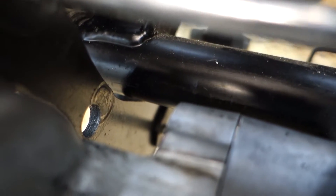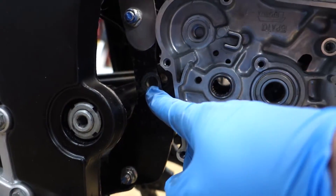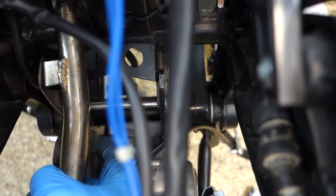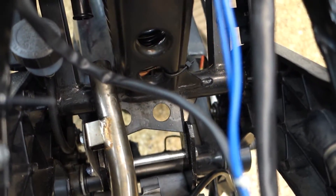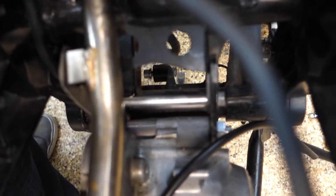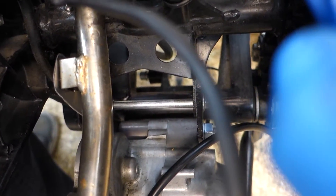There's the gap that the spacer fits in, and I'm going to throw that in right now and see how it lines up. From the outside, that's where this hole goes through — it goes to the edge of the case, right there between the case and the plate on the side. That will tie this whole unit together. You can see there's a continuous run between the cases and the plates, and that spacer takes up that little gap very nicely.